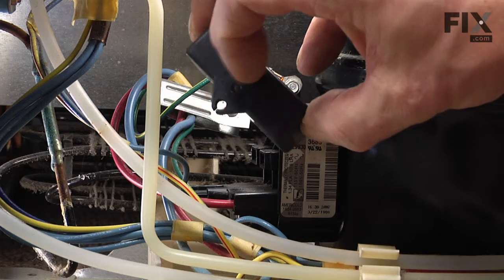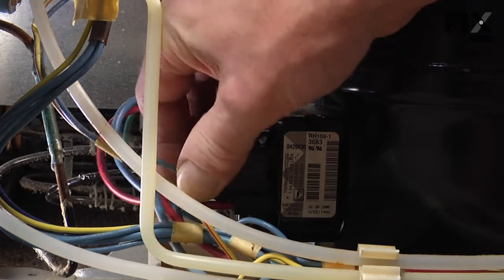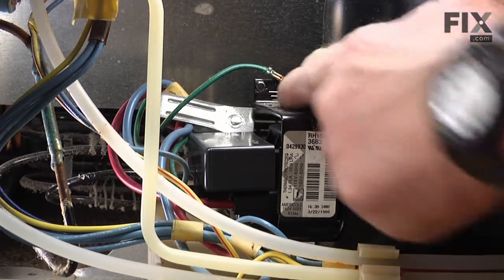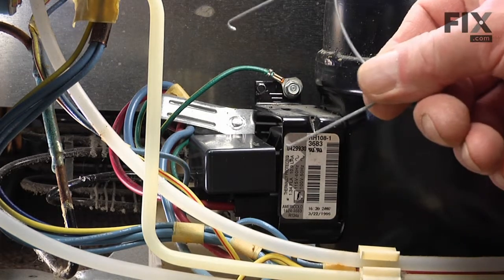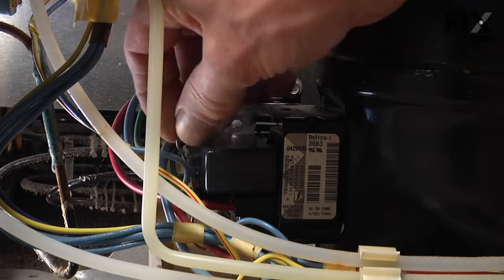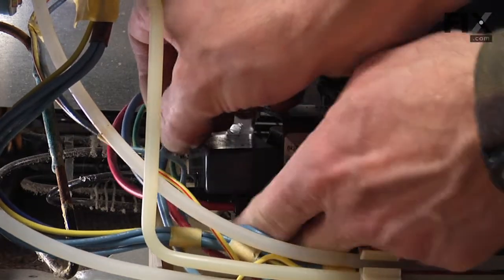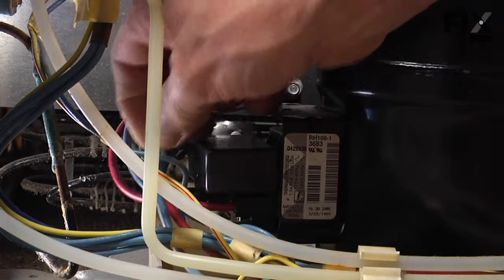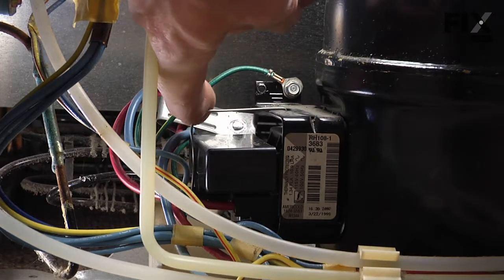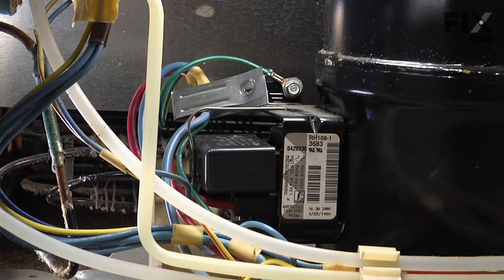We need to make sure that we have that hole over the post to hold it into place. Line the terminals up with the socket, make sure it fits snugly — there is an oval opening in the bottom of that housing that this hook will fit into. We'll hook the bottom one in first, then depress it enough to hook the top in, and we can reposition that clamp for the wire harness.